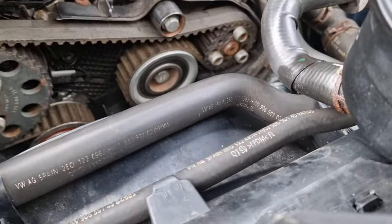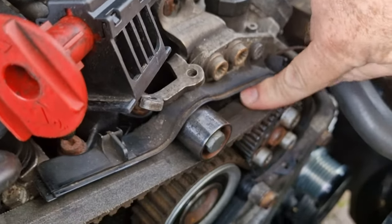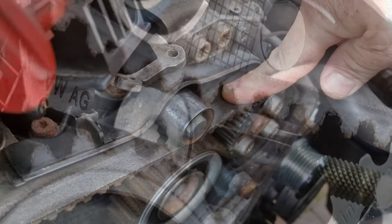The next point is on your diesel pump. Now in there, behind here, there are two prongs that stick up. You might just be able to see if I push that down a little bit. Maybe not. There are two prongs that sit up there. And behind that is also a slot to put a 5.5 mil pin in. So yeah, we're using drill bits because the pins have gone missing. So we've got the same size drill bits. They're around about 5.5 or 6, and they fit perfectly. A little bit painful when you forget they're there because they do cut, they bite. So safety tip, put insulation tape on or use somebody else's hands.